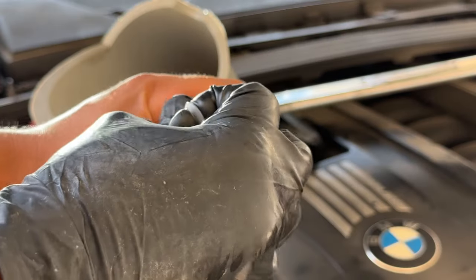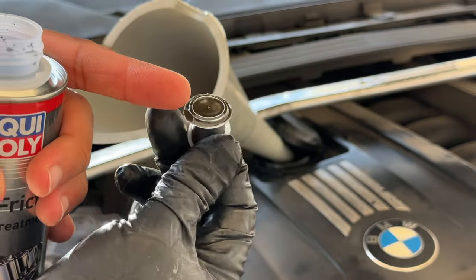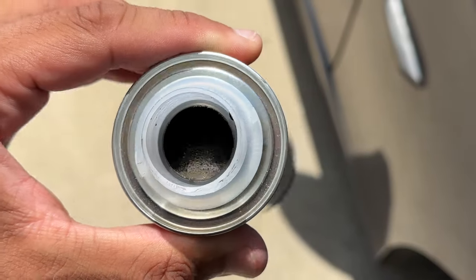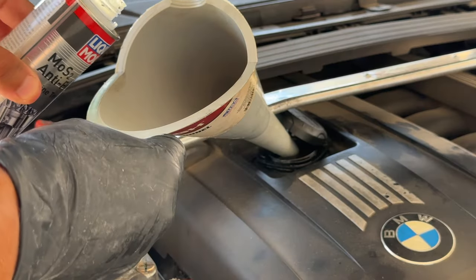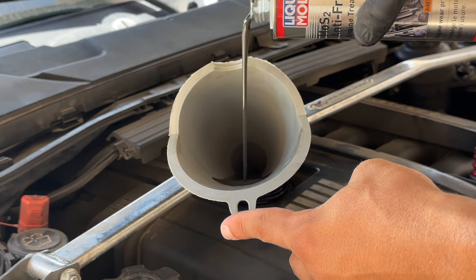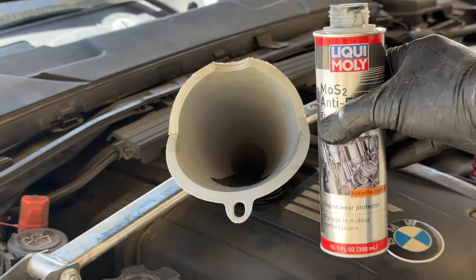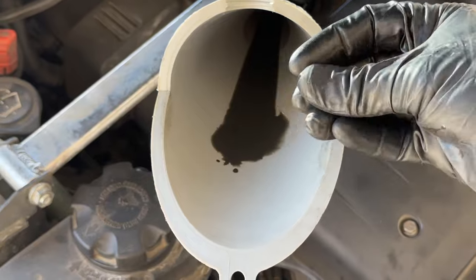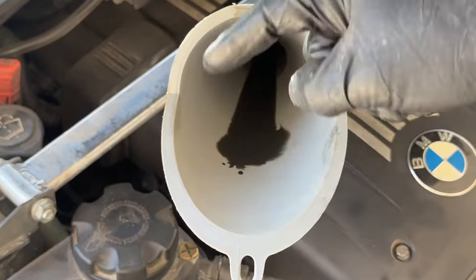Pull off the little ring that's in there. You'll see it's this really graphite color — that's because of all the additives and the ceramic lubricant. I don't know if you guys can see inside of there, but it looks almost like paint, it's a really graphite color. Now I'm going to go ahead and pour in about a third or half of this Liqui Moly. So that's about half of the little container. You can see that this stuff is very sticky because it really sticks onto all the hard internals of the engine. Now we're going to wash it down with oil.